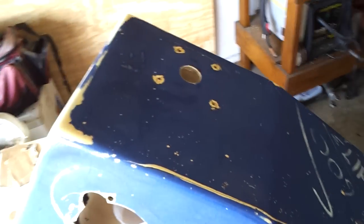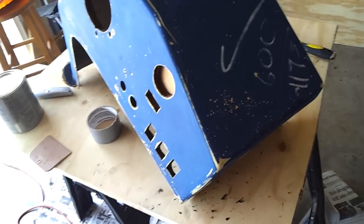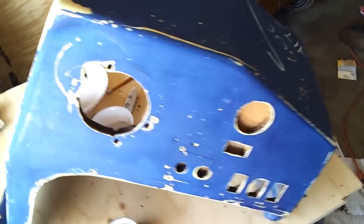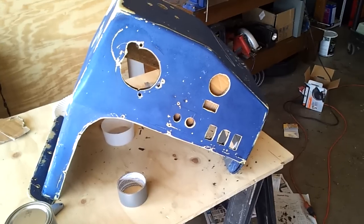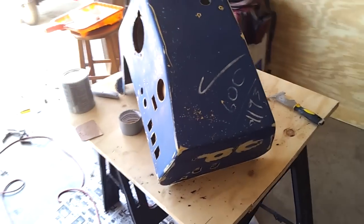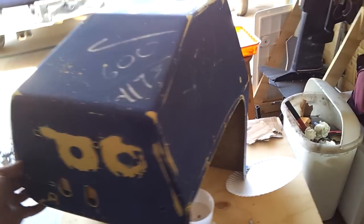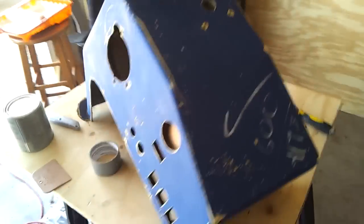Once the filler is done it takes about 30 minutes to cure — it's a chemical reaction so it heats up fast. You obviously need a mask and everything. After about 30 minutes I should be good to sand down with 80 grit and then step down to 220 again. Once sanding is done, we'll give it another spray, and then it's ready for the roll-and-tip application of the navy blue paint I've got — first time I've cracked it open for this boat. Hopefully the next video will show a polished, pretty-looking boat part and not this piece of junk with writing all over it. That's all for now.